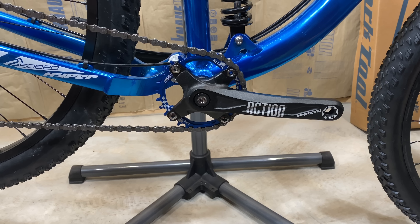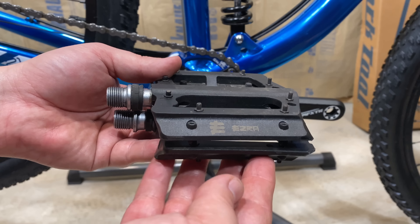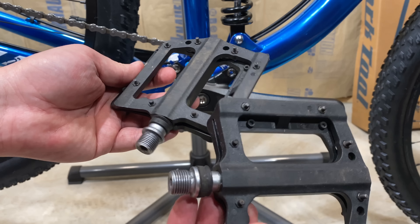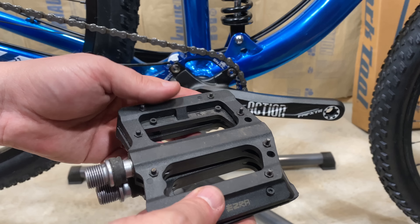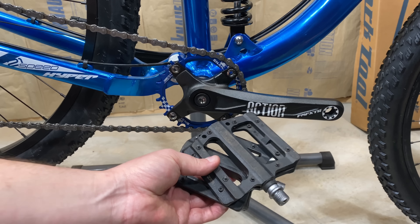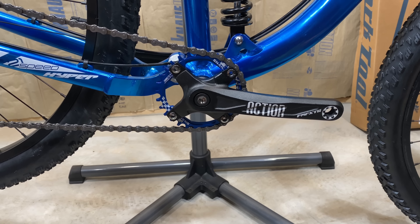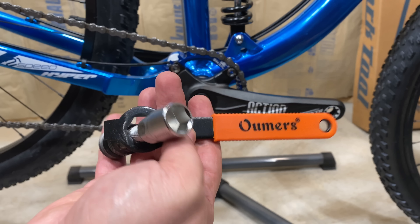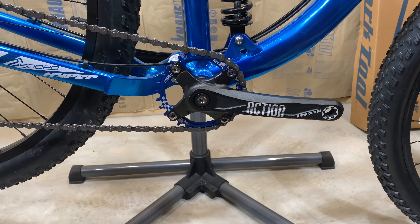And there we go — installed. A cheap, square taper bottom bracket-friendly way to go 1x on just about any big box bike. Of course it's going to need some pedals. I'm thinking about using those Ezra's I used on the original aluminum comp build — I still have them and I think they'll go well on this giveaway Hydroform with the new action crank arm set. So there you go: action crank arm set, comes with the Snail chainring, square taper friendly, minimal tools required — you can get away with only needing the Omer's crank remover. I'll put links in the description. Be sure to comment below if you found this helpful, subscribe, and have that notification bell active. Thanks for watching KevCentral!